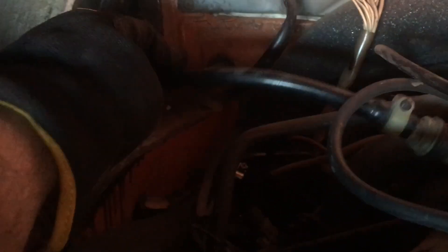Next on the list is the brake booster — that's this little vacuum line that runs from the brakes over here to grab vacuum off the intake. There's actually a little three-way T here. Mine's pretty stuck on, so I'm going to remove it after I get the engine off. But there's your brake booster up and out of the way. Hope you enjoyed — sorry we didn't finish taking the engine out, but maybe next time. Trying to keep these to a reasonable length so that people enjoy them and I can schedule them out at a reasonable pace. Don't forget to like and subscribe, and more content coming.